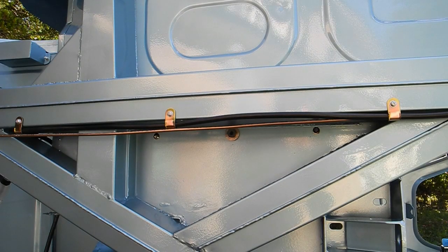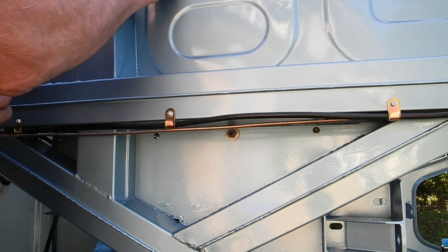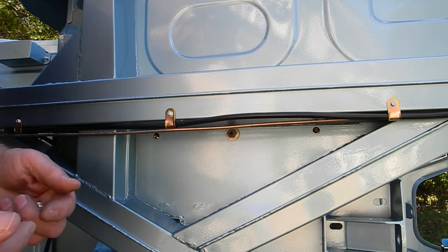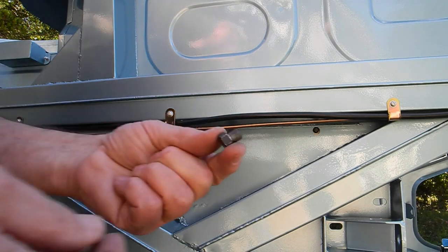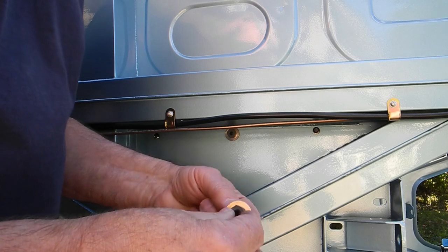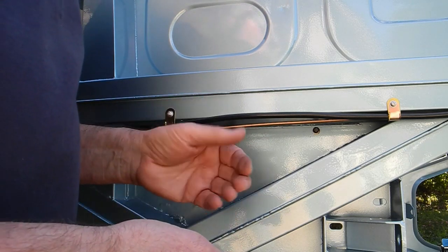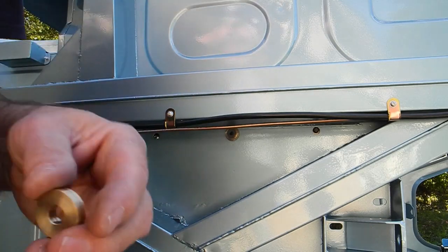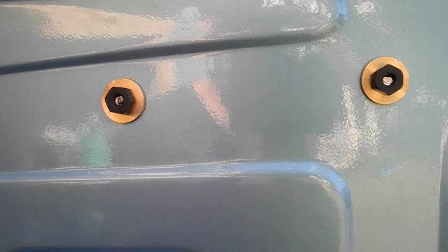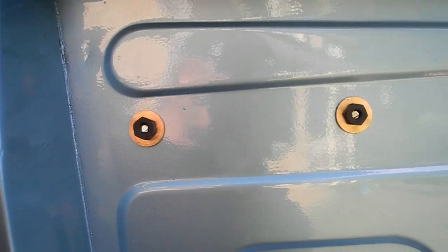And okay, the top ones are lined up, and you've got to be really careful with that because the plate can be sitting on the edge of the nut. So you see this nut needs to go through basically everything, and be aligned correctly. So it's very easy to either misalign the plate or misalign the wooden spacer. So to work on that, you just need to be very careful, and to make sure that you've got the same amount of thread sticking out on each of these. Can you see that? So there, I haven't put the Loctite on these, so that's what's coming next, but it is a little bit fiddly getting them all aligned correctly.